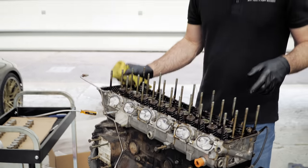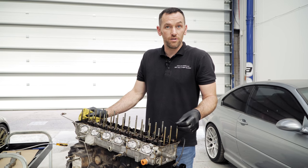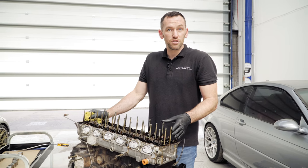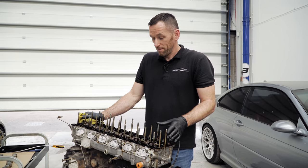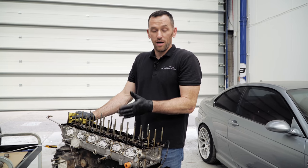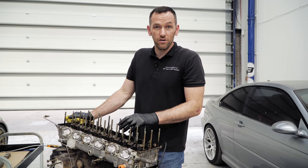What they used to do in the factory as well is balance the throttle bodies and measure the individual cylinder mixture to make sure it was correct, so you could balance individual throttles, whereas nowadays it's all electronic and done through lambda sensors. Computer controlled now, but back then it was really mechanical, straightforward, old school fueling. Balancing the throttle bodies is one thing, so I want to clean all the throttle bodies and then figure out how to either not unbalance them or learn how to rebalance them. If you don't touch any of the set screws, then generally they're still balanced, but there is a sort of elaborate process to do with them. BMW instructions tell you how to do it. It is relatively straightforward, it just takes a bit of time.